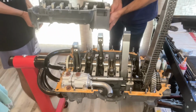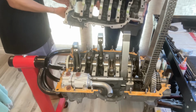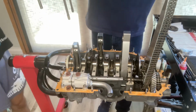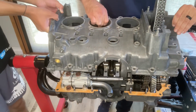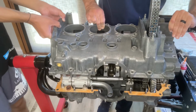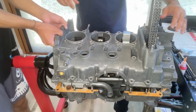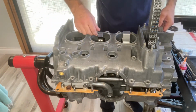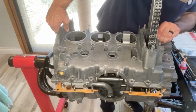Okay, so once the Loctite 574 is spread evenly around the perimeter, you want to go ahead and have the other half of the case ready to go. And in my case, again, I grabbed my son. He helped me carry the other case half over, being very, very careful not to touch any of the perimeter mating surface, right? That's been cleaned spotless. We didn't want any fingerprints on that, no oils or anything like that.